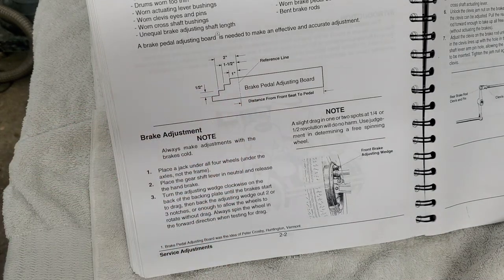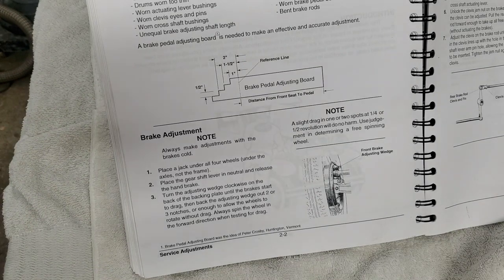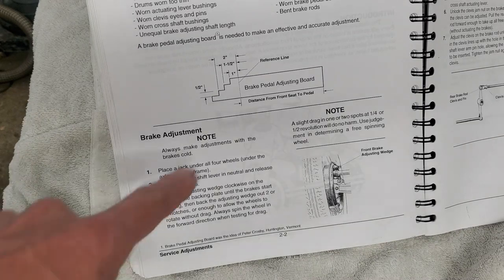But another thing he does different is he has the front brakes and the back brakes evenly adjusted, where the Les Andrews has a heavier drag on the back brakes. And when the back brakes are locked, the front ones should be not locked. They should just be very, really hard to turn. Which is better? I don't know. I think I'm kind of liking the Paul Shins way, although I did it the Les Andrews way,